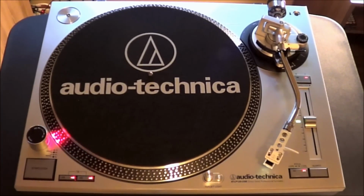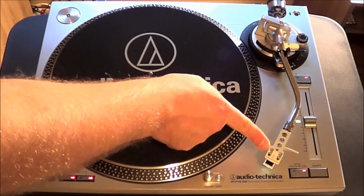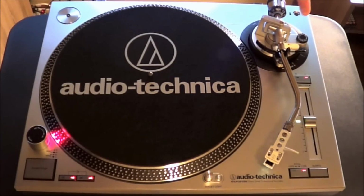And I got a lot of notes with me. Anyway, when I got the original unit, I did a general tune-up on it. I aligned the cartridge and set the tone arm weight and the anti-skate according to what played nicest with my two best read most difficult stereo test records.